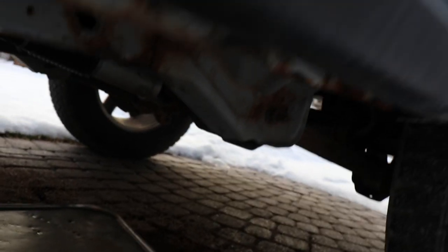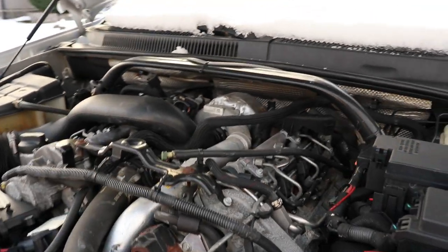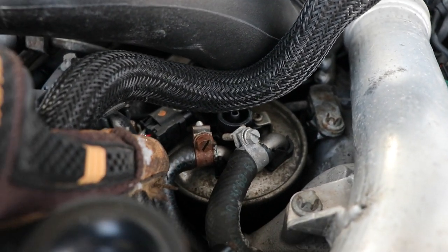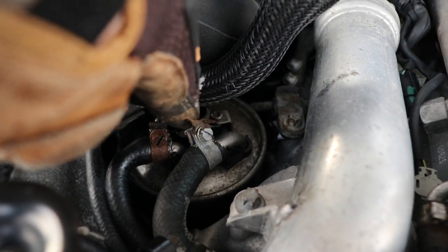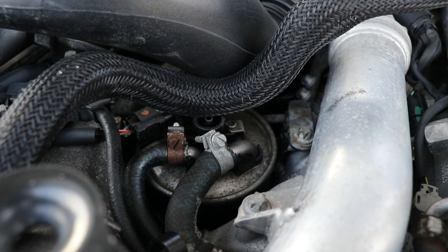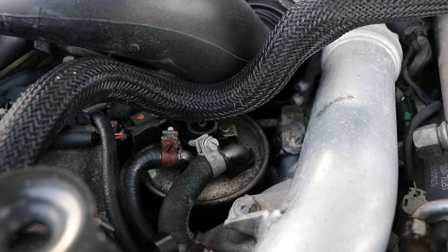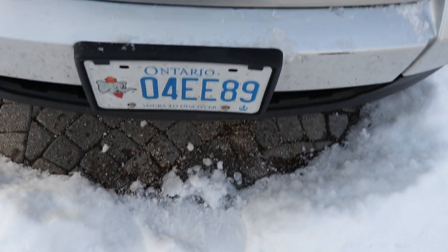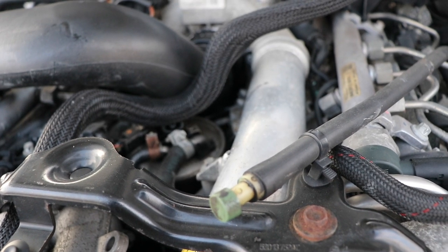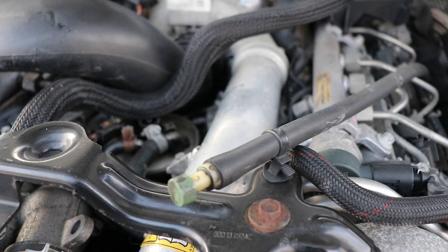It's easy enough access to get everything in there. To pump out the tank, what I did was go to the fuel filter, pull the smaller line off the fuel filter, put another rubber line on that fitting, and ran it into my pail. Then I cycled the key — the pump runs for about 30 seconds. Cycling the key about five times gives you about a pail worth of fuel. I just had pails in front of the vehicle and pumped it out that way. There was still about 10 liters left over, and these things are kind of environmental disasters — diesel all over the parking lot.